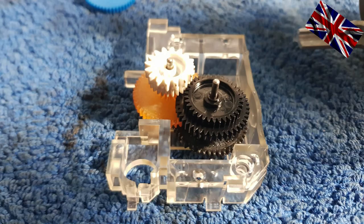Several different cogs are being assembled in the center part of the cluster, right behind the face of the odometer. The lubricant of the cogs is deteriorating due to time, becomes thick and dense, the cogs interlock with more tension and get worn out due to abrasion, wear and tear, increased friction, until the cog is worn out to an extent that it is not engaging anymore. There is a repair set with three cogs, the ones which are likely to wear out and break.